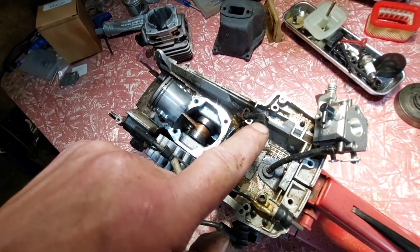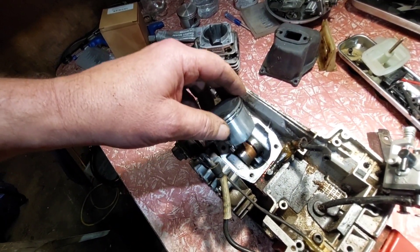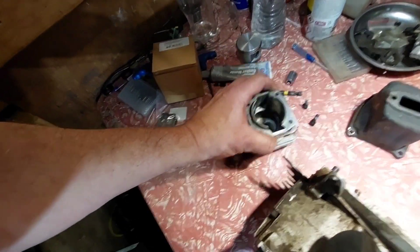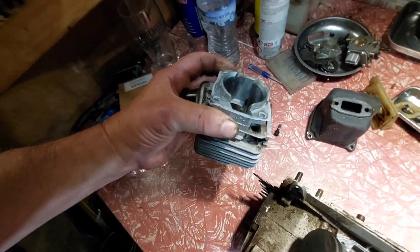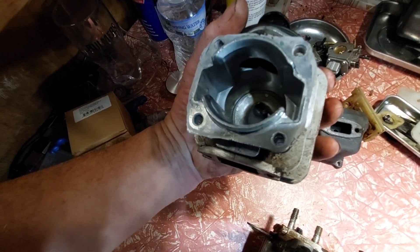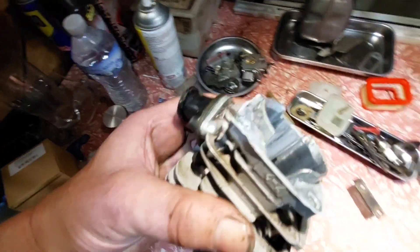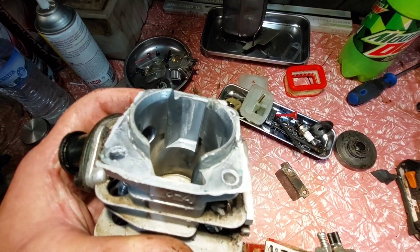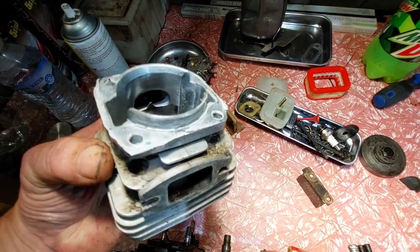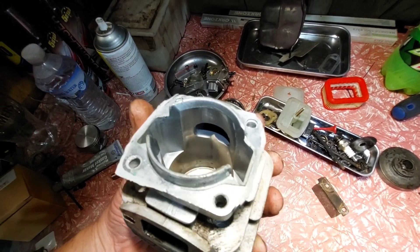There's a rubber grommet just where the air filter goes down. I'll pull the rings off and have a look. What the numbers are on the cylinder - the cylinder is a two transfer chamber setup. I can see no curve in the transfers at all - they're like a brick wall. Just slams down like a brick wall. So there's nothing special, not ported at all. But we'll have all the numbers and find out why it performs so very good.